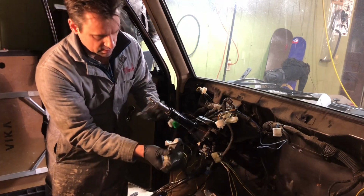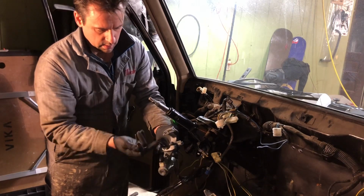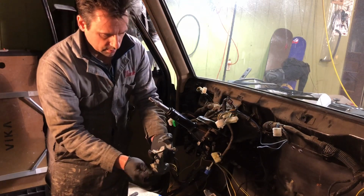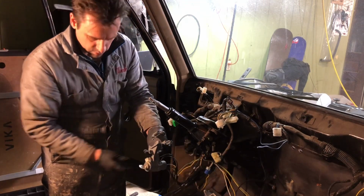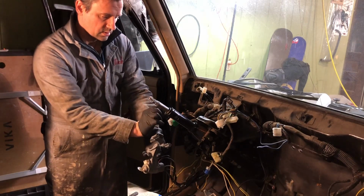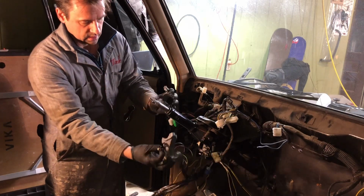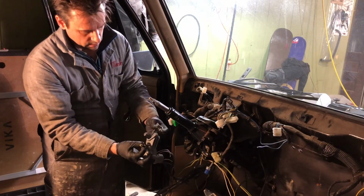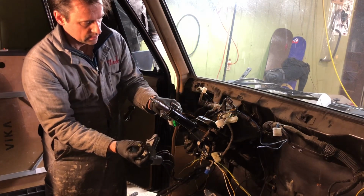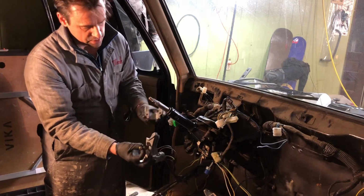This is the steering wheel lock. When you click this key, it shoves a bolt out there which grabs the steering column. And the reason that those bolts are smooth on this side is that the manufacturer didn't want a car thief to be able to just unscrew it and disconnect the lock that easily. So I'm going to just shim this backside with some rubber tape and then tighten it down, and that should do the trick.